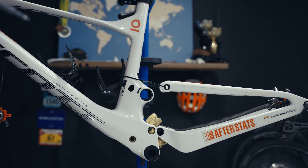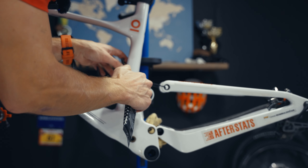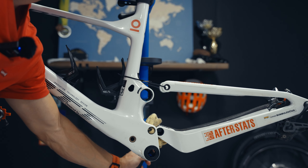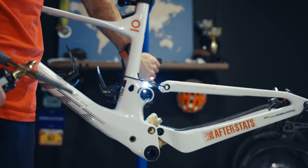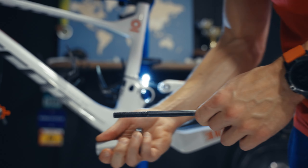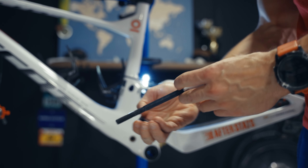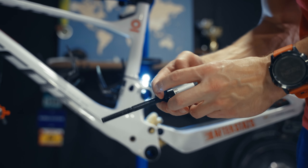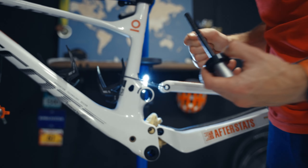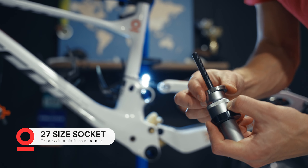What I'm doing while adding the bearings is applying some grease inside the frame. Some say it's not necessary, some add the grease on top of the bearing before adding it inside — I'm not exactly sure what's the best way. Just to make sure that the bearing slides a bit easier, since I'm not using proprietary tools, I'm adding grease inside. Initially I thought I'd press it with the bottom bracket tool, but then I realized its diameter is too small and would put too much pressure on the bearing itself, so I decided to use a 27mm head instead.